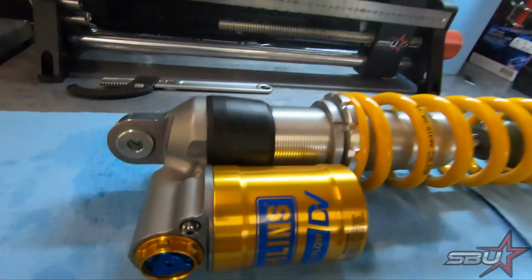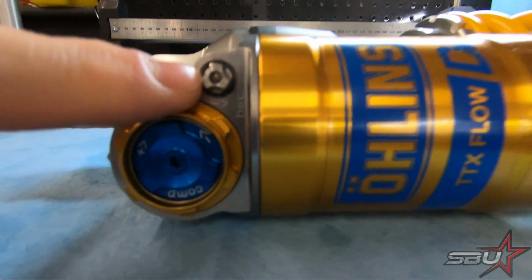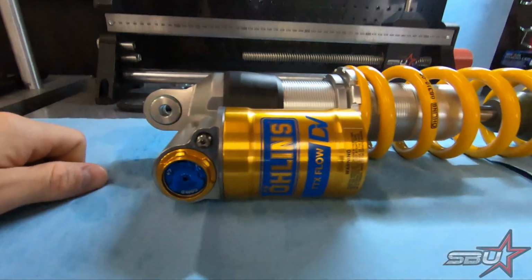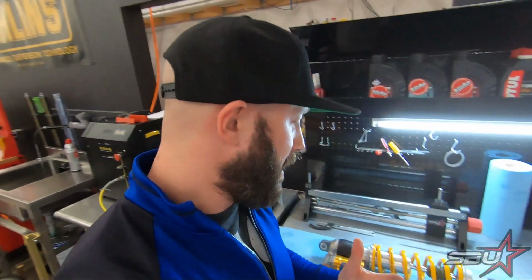What's amazing about that new shock, the DV, is basically this is our new adjuster that we get, which is high-speed compression. And back to that setting talk, say with a shock absorber, just as a very broad example, not something you run in this, say a shock comes factory with a compression shim stack of a C5 is what it might be called. It's something that we see in a TTX like Superbike or road shock. And that basically changes how it handles high speed, high velocity damping.